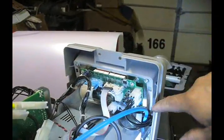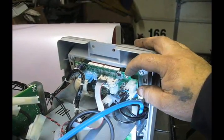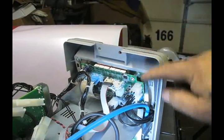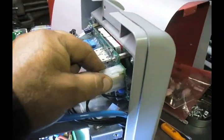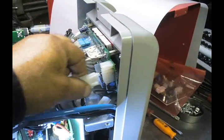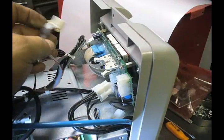We're going to undo four little nuts and then undo some of this cabling. It's very simple and straightforward. We're not going to touch this cable here — we're going to remove this cable, these two cables, there's a cable below and one over on the other side. Cables like this are just push connectors — you push this connector and lift it right out. This one in the middle has wings that spread out and it just ejects the cable just like that.